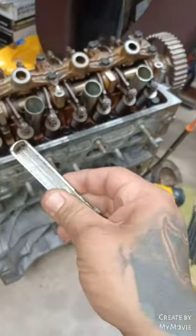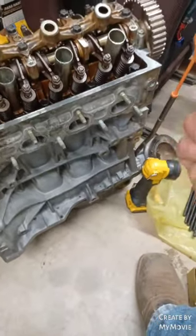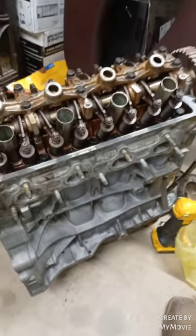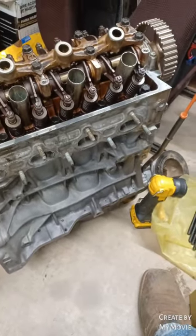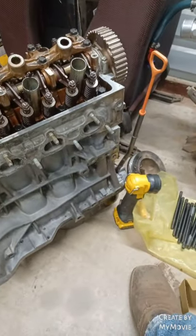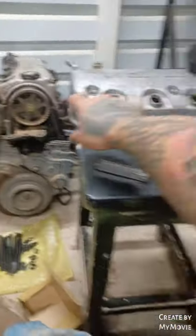All things I've got left: valve lash — I got my feeler gauges right here. I've gotta put the crank on it so I can bolt it down and turn the engine to get the pistons to drop a little bit, so when I'm doing my valve lash the valves aren't hitting the pistons and potentially bending the new valves I put in. So I'll probably make a trip to the junkyard for the crank bolt and crank pulley. Also need the oil filter, spark plugs, and spark plug wires.